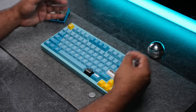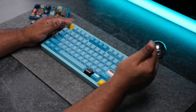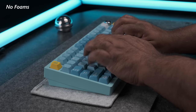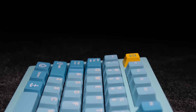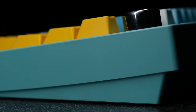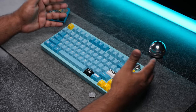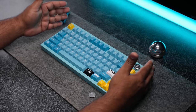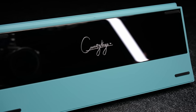Hope that build tutorial helped you out. Overall, this keyboard actually surprised me. From a sound perspective, I like it a bit more than the QK60, which I already really liked. I would recommend using long pole switches since the flex cuts can make the board sound a bit thin, or tape the flex cuts up. The case design is really clean — the glitter spray finish is nice if you have the right lighting on your desk, though it's a little rougher to the touch compared to anodized and it's hard to say how it will hold up over time. Typing feel and sound are all pluses. This is a QK board so it's going to sound best with all foams in my opinion, but no foam did sound pretty good as well. In my opinion, this is the best keyboard that QK has made so far, and I'm excited to see what they come out with in the future.